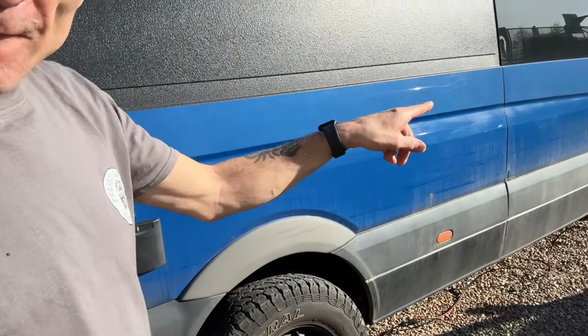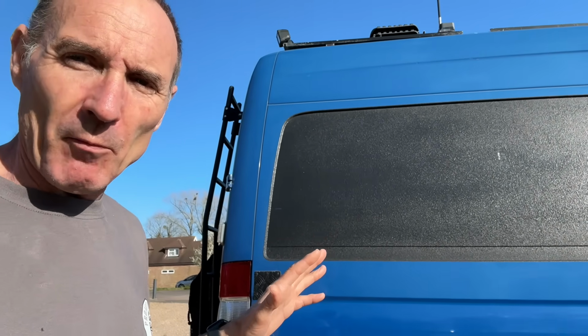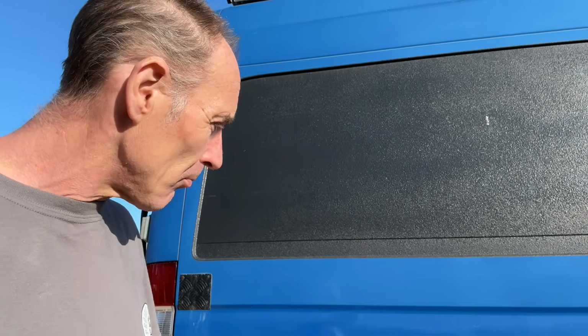More General Grabbers. The front has got a 5-ton front spring on it, and the back I've just basically used what Mercedes used to use, blocks. Now if you are a regular of the channel and you've subscribed for many years, you'll see that it used to have airbags on the back of here, and they split the chassis, which was not great. I don't recommend them. Mercedes-Benz don't recommend them. It's just a bad idea. The way they work is basically like if you put a piece of wood over your knee and snap it. That's what it does to the chassis, even with strengthening plates. Anyway, I expect people will disagree, but you can see from my videos that yeah, my chassis split. So there you go.